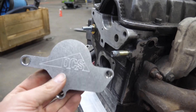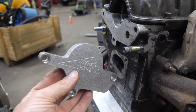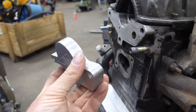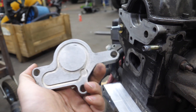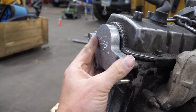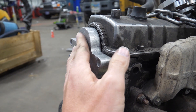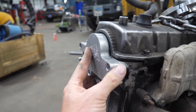We also developed a vacuum delete, for two reasons. For these earlier trucks, it directly replaces the vacuum pump — it uses the factory Volkswagen O-ring and factory fasteners and just bolts on in place of the vacuum pump. It buys you a little bit of extra space back there without requiring any firewall work at all.